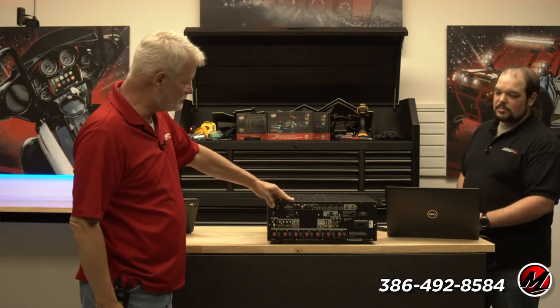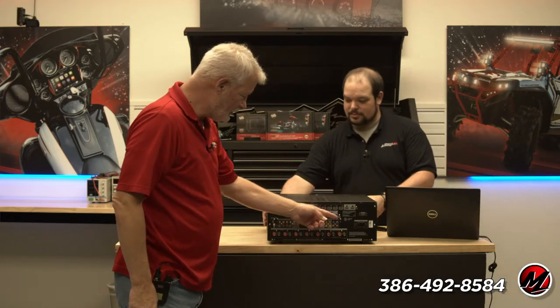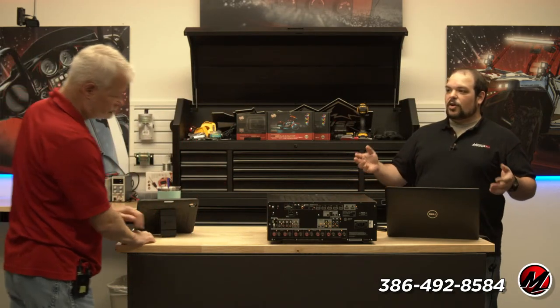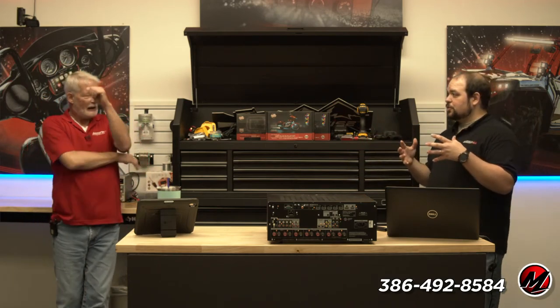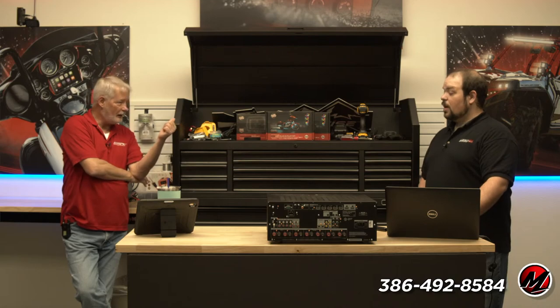Composite video lasted into the 2000s. Onkyo Integra and DNM still had S-Video. What you see on the back hasn't changed much — this Sony 1100 still has component in, component out, and composite inputs. Nowadays we've taken all those RCA connections and condensed them down to one HDMI, because if you had component you had five RCA connections for RGB analog plus digital optical.